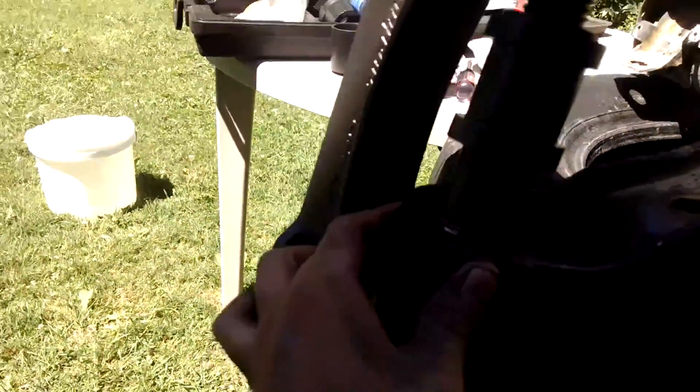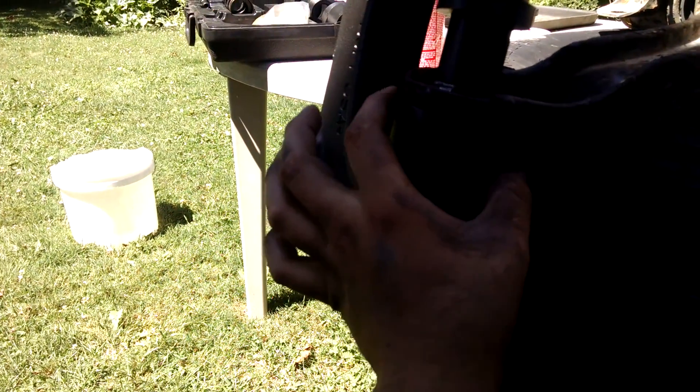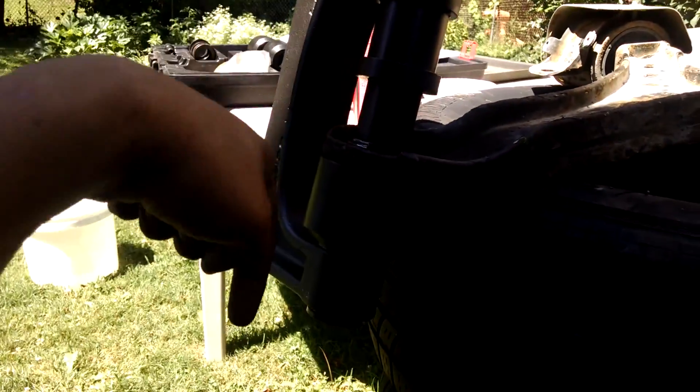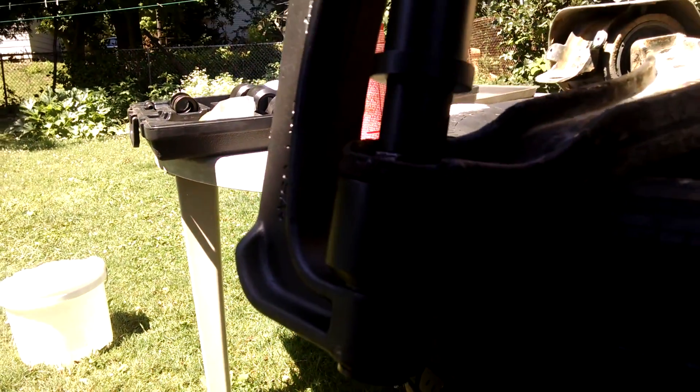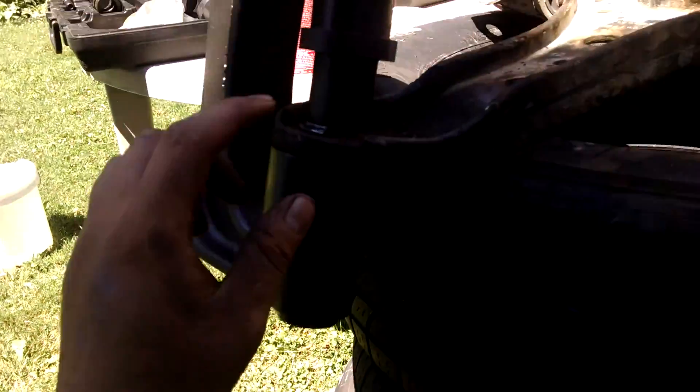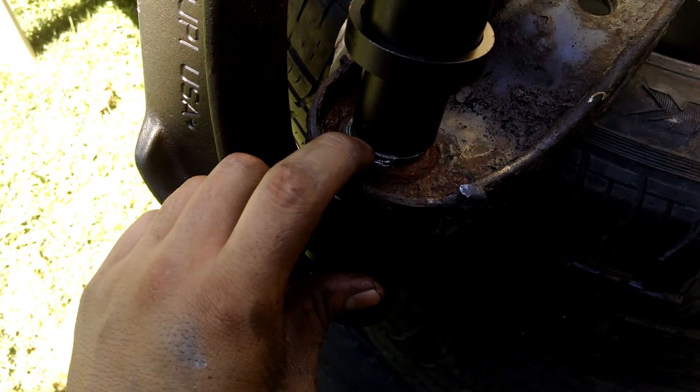The way this ball joint is supposed to be taken out is you're supposed to press it down and the ball joint itself is supposed to come out this way, so it's supposed to go down. That's why I have this setup — basically the stud was just too long. What I found out is something completely different from what I've been reading. The ball joint itself does not have a snap ring at all. The lip at the end of the ball joint flares out all around and kind of hooks to the control arm. As you can see, here's the lip and it's flared out. I also kind of ruined this side because it slipped on me and squashed this end, which clearly made it visible that it has a flared lip.